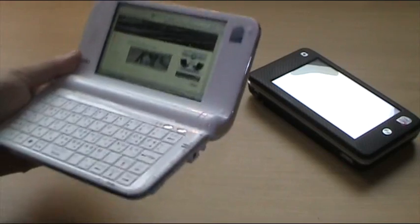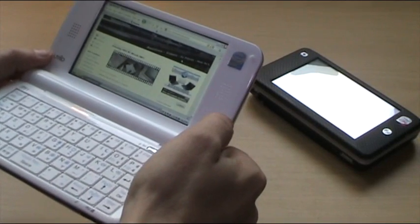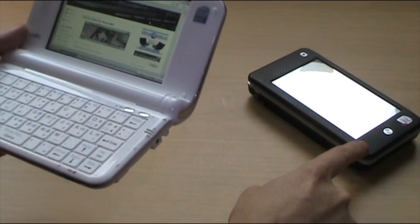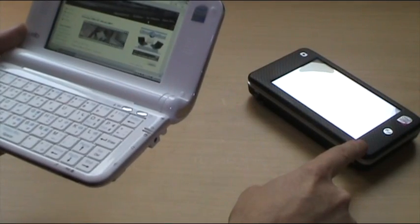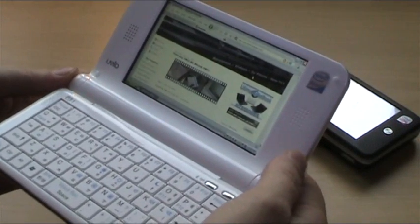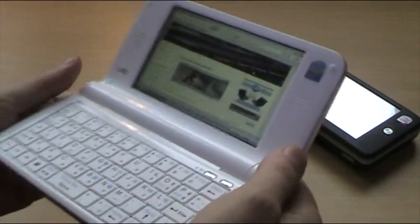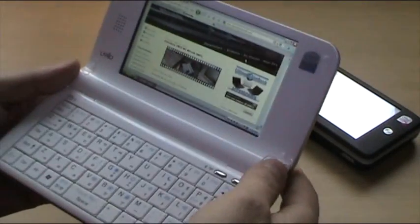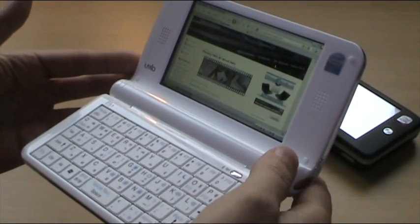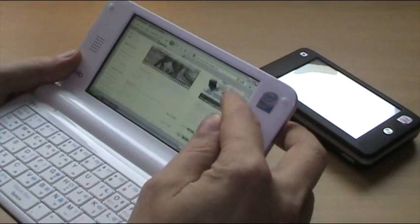So one really good thing I have to mention is that the processing power on this device is much better than on the iGo. In terms of use, I have embedded XP with write filtering on iGo, and full XP Pro without any modifications here on UMID, and still it feels a bit faster on some occasions. Sometimes iGo feels faster, but if you have normal XP Pro on iGo, it will be much slower, and that's because this has a better CPU. My model has the 1.1 GHz Atom CPU, but the chipset and the graphics are much better on this one. So processing power wise, it's cool.